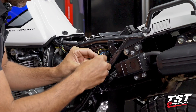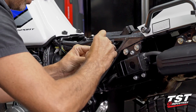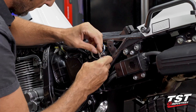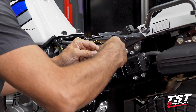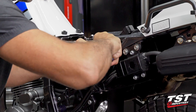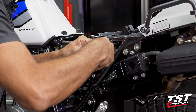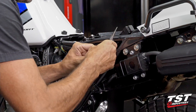These are fairly tight because it's a new bike. If they've been on the bike for a long time they can also have corrosion built up, making it even more difficult to withdraw them. We can employ needle nose pliers to get in there, grab the crimp, and pull it out. If you pull by the wires you run the risk of pulling the wire out of the terminal, so we don't want to do that.